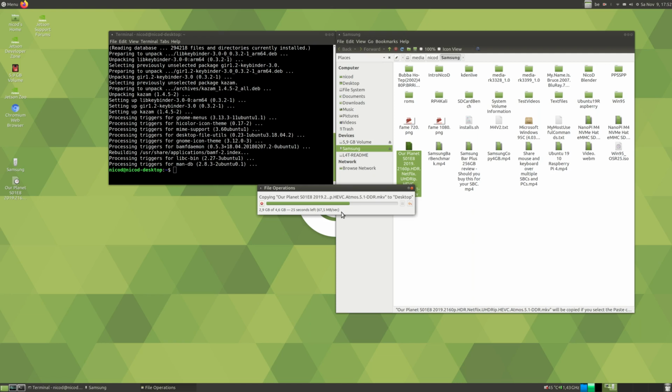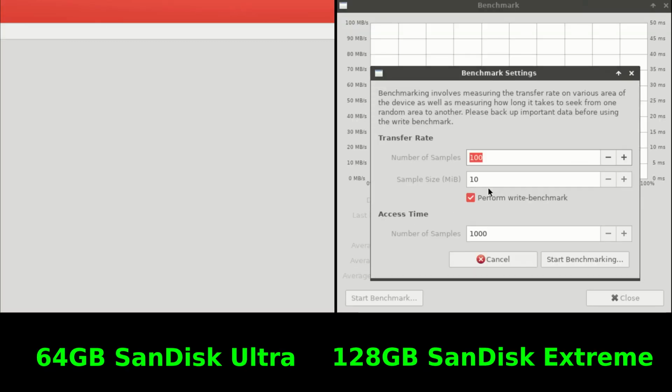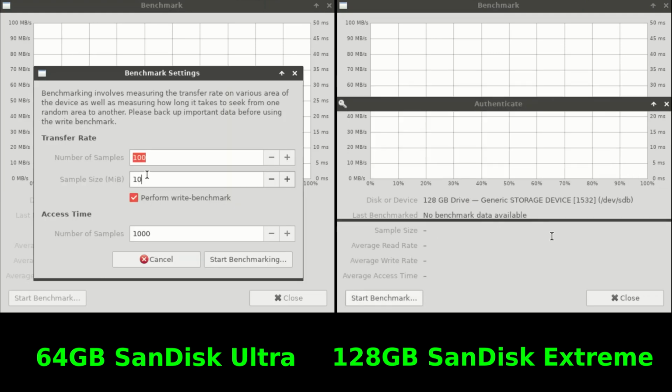So my conclusion is most of the SD cards have a very good read speed, but the write speed of many isn't that good. So it is best to have an SD card that maxes out the SD card reader on your device, so it can be important to investigate well what's faster and what fits your device. Certainly for a 4K camera the write speeds are very important.